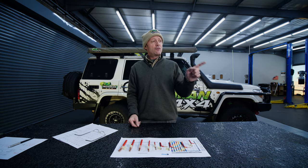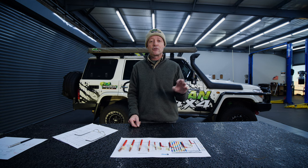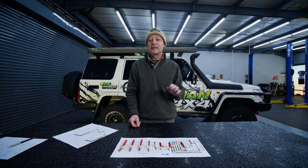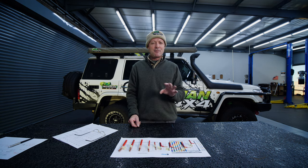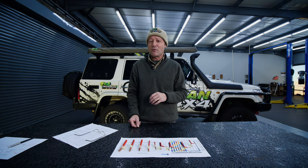So what does that mean? As soon as you plug the fridge into the back of that vehicle and switch it on, the voltage will drop down from 13.2 volts — which it was before you drew power there — down to 12 volts. Now the fridge may still run at that voltage, but if your main battery is down to, let's say, 12.8 volts, your fridge is going to cry foul and probably switch off, or even worse, cycle between on and off — damaging the fridge and potentially damaging the electrical system in your vehicle.